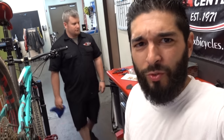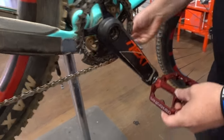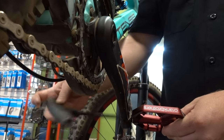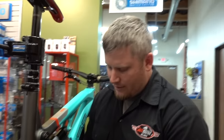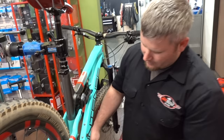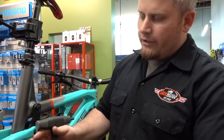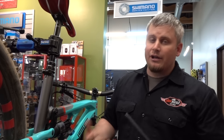I'll put myself out there — about four months ago I drove out to San Luis Obispo, got out of the car, and was trying to put my pedals back on and they wouldn't go on. Lo and behold, I was putting my left on my right. I could have saved myself four minutes of stress. Usually what you do is start the pedal in, put the Allen wrench through the back, slowly thread it in. There should be a pretty defined stopping point. Then switch to the T-handle Allen wrench for a little more torque — they don't have to be super tight, because too tight and they'll be really difficult to get off. Use a decent-sized Allen wrench and you'll have plenty of leverage. Pay attention to right and left specific pedal threads, and make sure they're going in straight so you're not cross-threading.